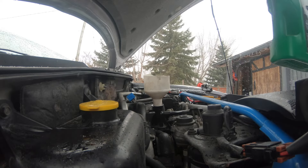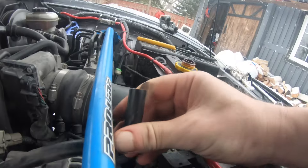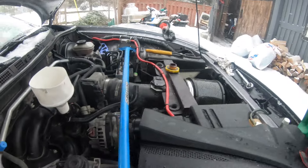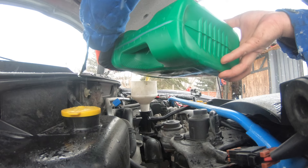One other thing that's good to do: if you dump the oil too quickly, it'll come up this spout and it can come through this tube and then dump into your throttle body. So it's good just to disconnect that, pour four quarts in, and then go from there.